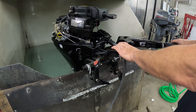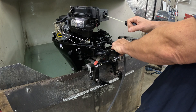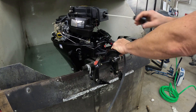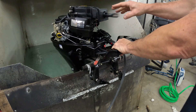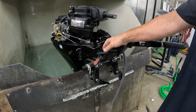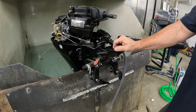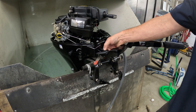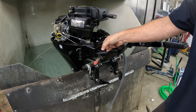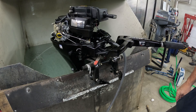Choke. Make sure we're in neutral. We are already primed with fuel. Going to half choke — oh, that's why it was hard to start. The choke isn't hooked up. I think what happened is a customer came in and needed a choke knob, so we popped one off this engine and sold it to him, and then whoever put this back in neglected to hook it back up. But that's okay — you can actually see these do start without the choke. Let's let it warm up.